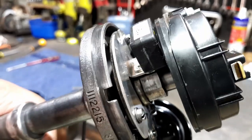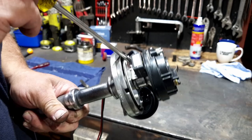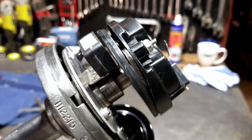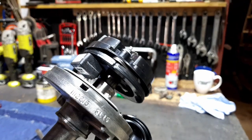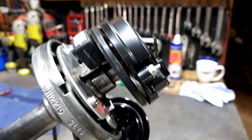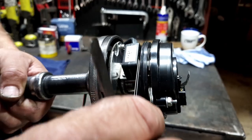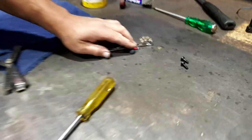I've now got way too much gap. Okay. So now you'll get it a bit closer. Okay, so that's got a pretty big gap there at the moment. But it's parallel. Okay. So now we do the shim with a washer. Now I'll have to shim this ring down, I'm pretty sure, because if I grab the feeler gauges and put that at its maximum and find its highest point, which is there, and run that under, I guarantee that's way too big a gap. Okay. So now we'll have a kit. See these little washers here coming in the kit? Yep.